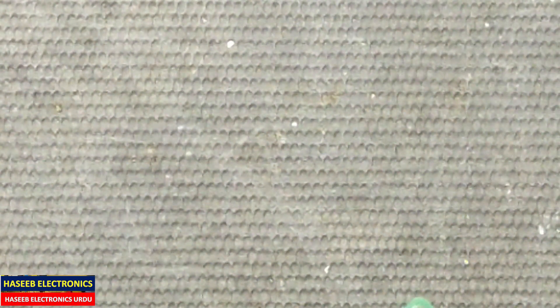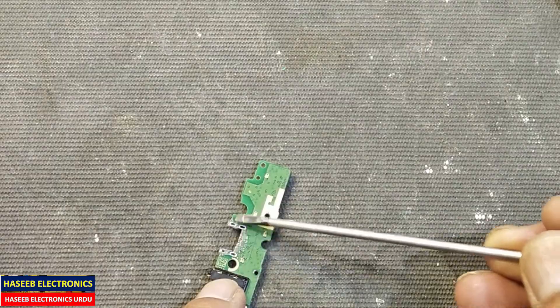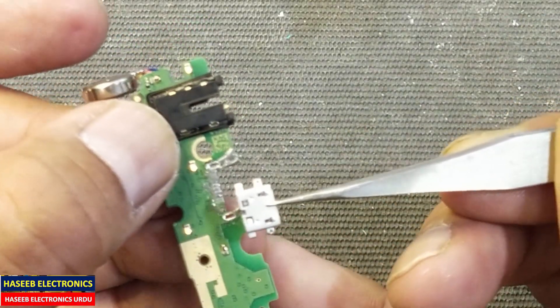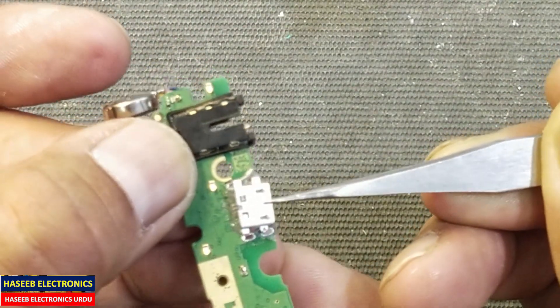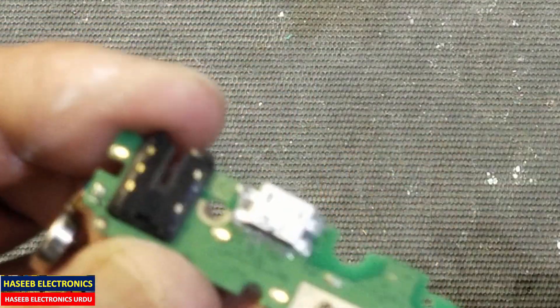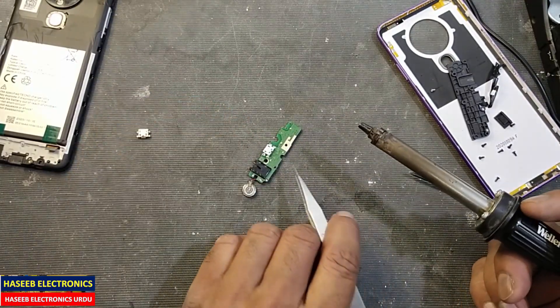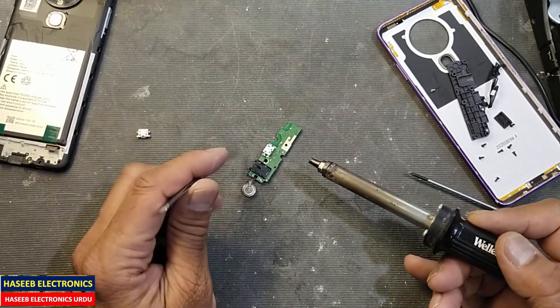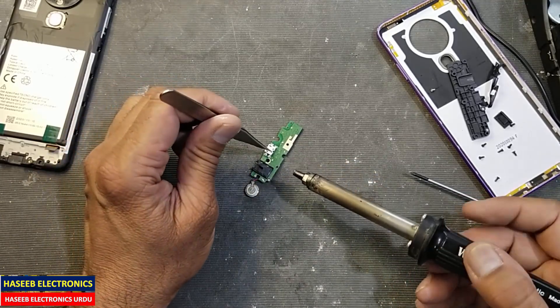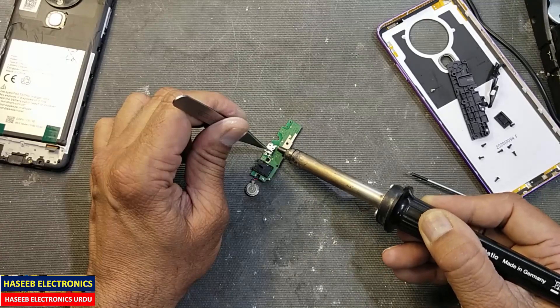Now I will apply a little amount of liquid solder — it will just become a layer of solder, and when we heat it up it will touch the points. After applying a little amount of liquid solder, place the charging base into the holes. Because we removed the old solder it placed very easily in its place. Now from the same direction — inside to outside — giving airflow, we will heat it up using the hot air gun. Apply the hot air equally.